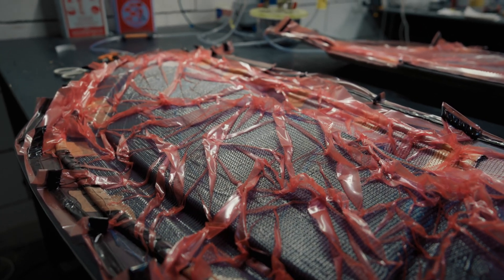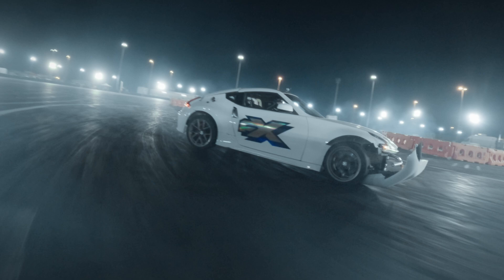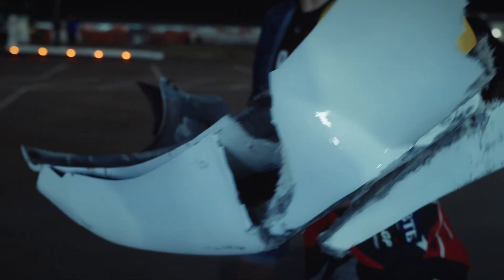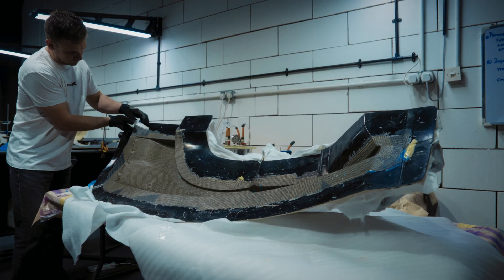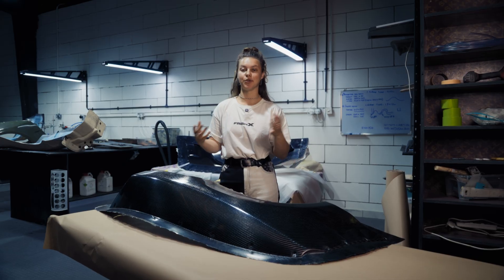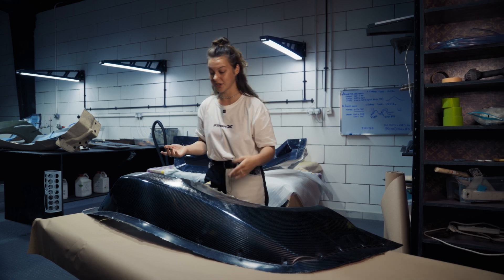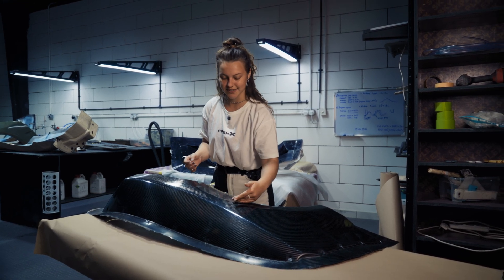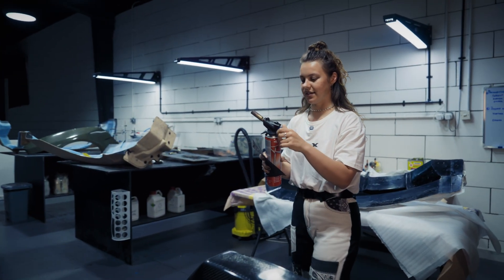There are two main features to focus on when manufacturing a body kit: it has to be lightweight and impact resistant, meaning when your car takes damage or a crash, it has to remain stable — no shattering, no cracking. That's why the first material we use is carbon kevlar. Kevlar is impact resistant and doesn't crack or shatter, while carbon is more rigid, more lightweight, and distributes energy more efficiently — but it tends to crack. In combination, they are ideal. The second option is pure carbon fiber. We made one of the flares from this material. It's similar in cost but more time-consuming because you have to layer the materials more precisely compared to the random layering of carbon kevlar. A key benefit: carbon is not flammable and doesn't burn.